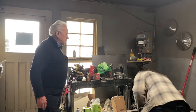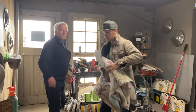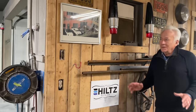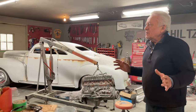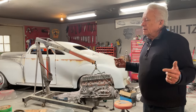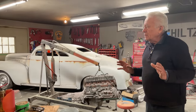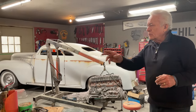Okay. I didn't tighten the camshafts down, so the valves aren't extended. Yeah, okay. As soon as you tighten those down, now you've got an interference, and I'll show you what I mean by that. That's an interference engine. I'll show you just how much interference it is if the cams are in the wrong position and you tighten them down. The intake valves will hit the exhaust valves. Wow. Yeah. That's just how touchy they are. So you have to have them in the right orientation before you crank that down or put it on the engine.